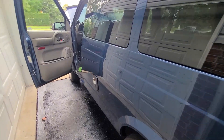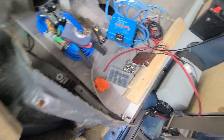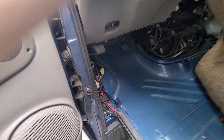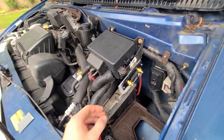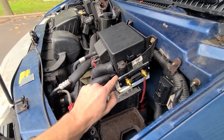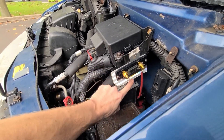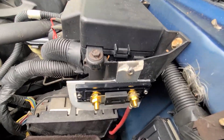Another quick update on the DC to DC charger wiring. First things first, you've got to find a place to mount your fuse. I fabbed up a little bracket here made out of a piece of scrap metal, left a little room for expansion just in case. That's going to be a nice short wire run right into the existing hole, and I've added a grommet.